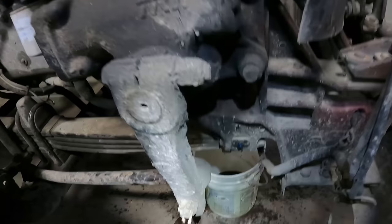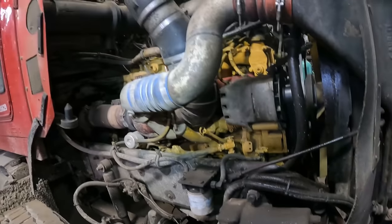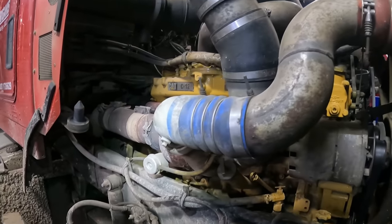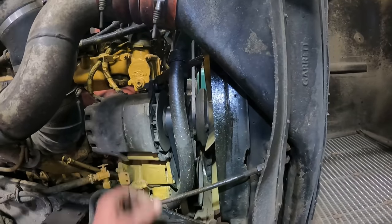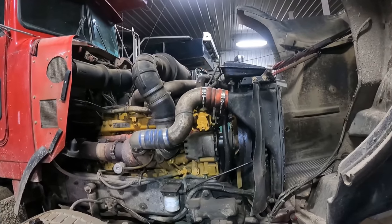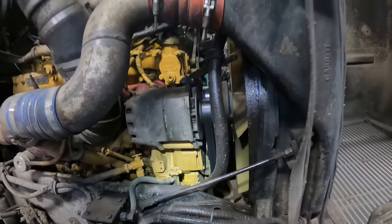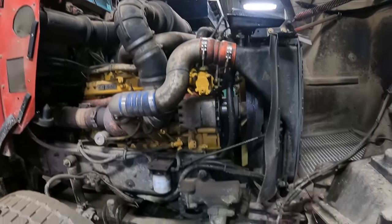The third pail was mostly oil — it was black as hell. So we've got to get the turbo off and get everything opened up so we can get down into that oil cooler. We're going to have to change some hoses out here because if this oil has circulated through these hoses at all, just by what we ran into with the 9560, the oil ended up ruining all of the radiator hoses. So we're going to have to replace all of them, or we're just going to see the problem down the road be a bigger problem.